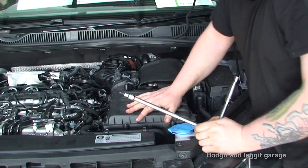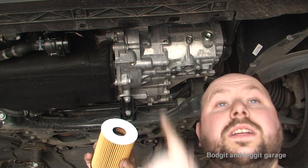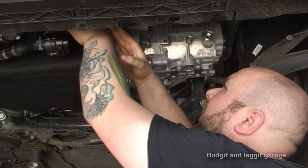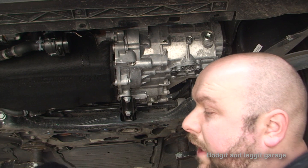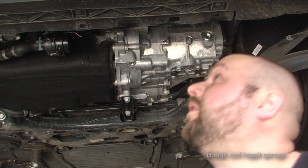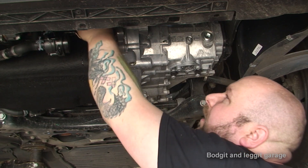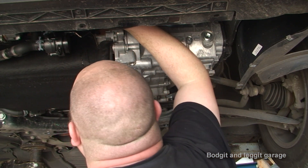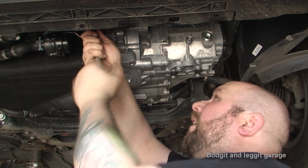Sorted! Now we need to lift it up and do the oil filter. We're going to put the filter in first — it just makes life a bit easier. The little locking tab goes down onto the filter housing and the big hole slides up through it. Make sure the O-ring is good — no cracks or anything. If it is, replace it, but if there isn't, there's no need to. Screw the cap in by hand as much as you can — don't cross-thread it. There is a torque spec on this, normally around 25 Nm. Get it all the way up first and just give it a little nip. Be very careful — you can break these so easily.